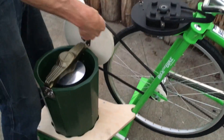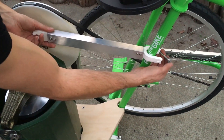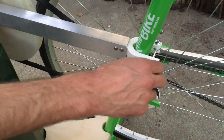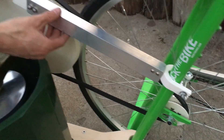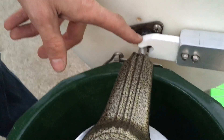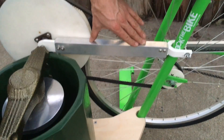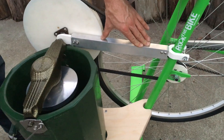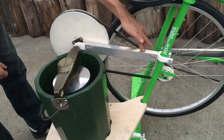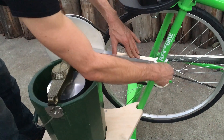Then we're going to take the spreader — it fits around the fork blade, same wing nut mechanism, just to hold it on there. I'm going to do it real loose at first so it can still slide, then put the notched end over the axle. I'll push the whole bar down, and that will push the bucket away from the bike, tension the belt, and hold everything relative to each other. I'm going to push it down to about there — not pushing real hard — then tighten it up so it won't slide up again.